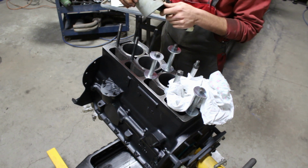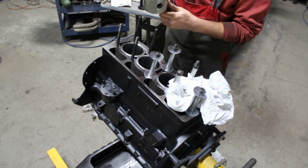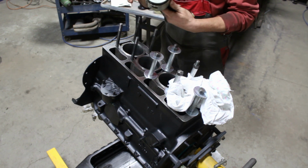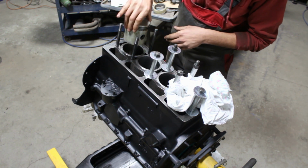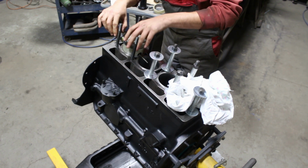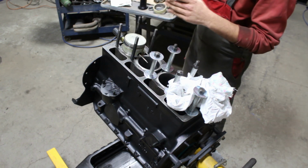So we say the oil ring is gonna point back, which is here, back. One of the compression rings is gonna point there, and one here. 120 degrees. Now I'm gonna drop it a little bit. Drop it in halfway. I'm gonna put my screwdriver through the pin, and here I'm gonna try to install the ring compressor. I'm gonna put some oil in it too.